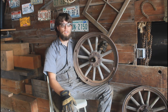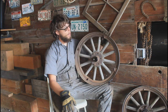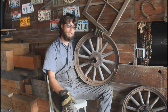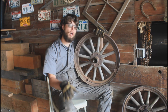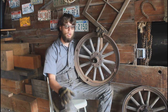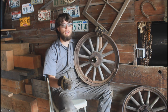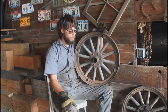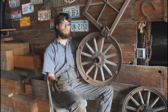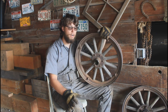Hello and welcome back. Today we're going to be looking at the wheels of the Model T. Here I have the front left driver's side wheel that came off the car. This car is a 1927 and it had the option of demountable wooden spoked wheels. These cars were offered with wire spoked wheels, demountable wooden wheels, and the older clincher type non-demountable wooden wheels. This car had the demountable wooden wheels, which are arguably the more desirable style of the wood spoked wheels because it is way easier to change the tire on them.